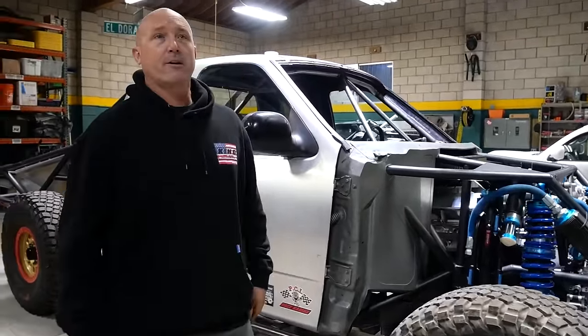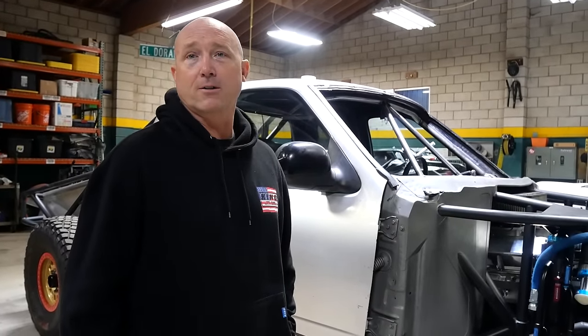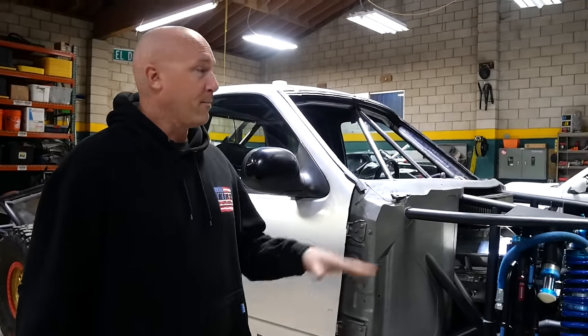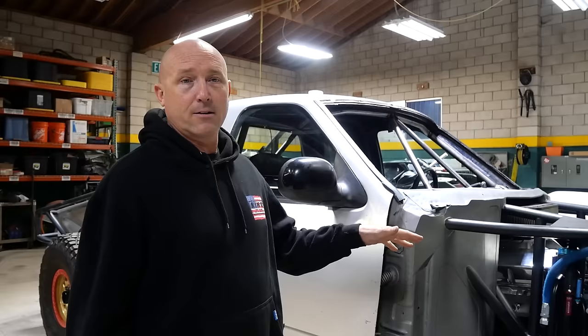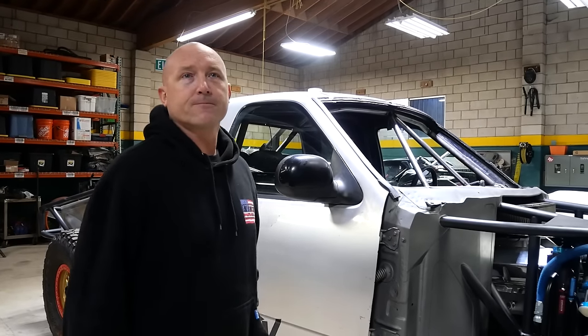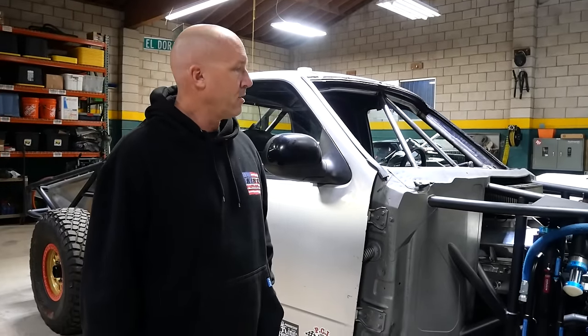The origin story is the Murray brothers, who are sponsored by Can-Am — this factory Can-Am team. He has a dealer license. So we went to an auction and got the F-150 there. It didn't have much damage. Then I built the front end for it — probably 18 inches of travel. It had leaf springs in the rear. Notched the frame, caged it, and then we pre-ran with it. We had two gas tanks for a while — the stock one — and then I finally put a fuel cell in it.